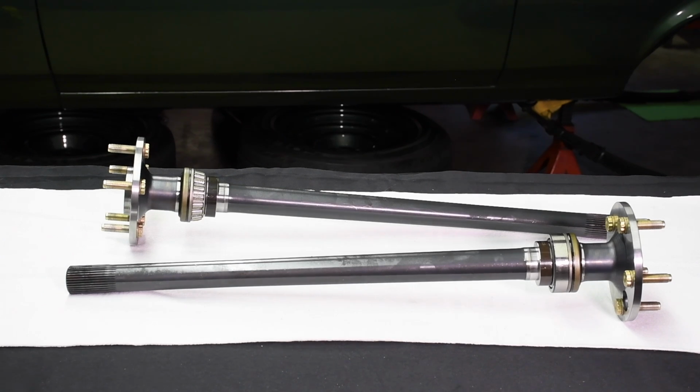If all of that is necessary to build good axles, why do you see alloy axles advertised so cheaply? The truth is, they're not alloy axles. These manufacturers produce an axle blank and fly cut the splines, often with excessively long splines. When an axle order comes in, they simply cut off the excess. In contrast, Mark Williams axles are built to the correct length with shorter splines, but still allowing for 100% engagement in the differential. If there's an excess unused spline, then the torsional capability of the axle is reduced. By the way, those other alloy axles have the same heat treatment as stock axles. The only real difference is they are available in shorter lengths and with different splines. Now you know why they're cheap.